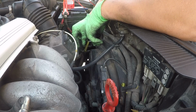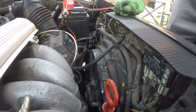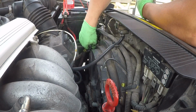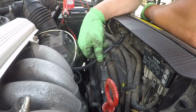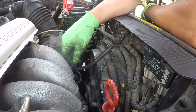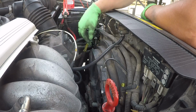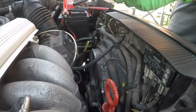Alright, so let's go ahead and put in on the valve. So we already got silicone spray on that. Let's grab a clamp. And that's on there very well. So that's all you need for those. And now that's gonna have no leaks. By the way, the lines here, I'm gonna just say, this one here is a 4mm inner diameter. This one's about the same, I think 3 or 4, but you get the special elbows for it. And the ones I'm using here and the one that's gonna go up to here are 8mm from memory.